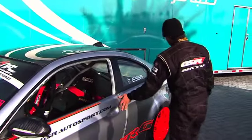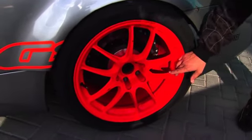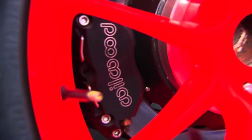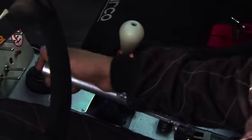In the back of the car, we've got dual calipers. One is for the regular foot brake and one is for the hydraulic handbrake. We separated those so we can use the foot brake and the handbrake at the same time without any feedback between the two.